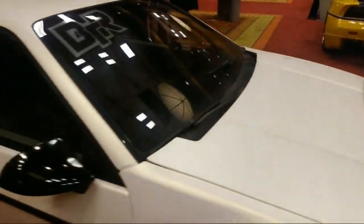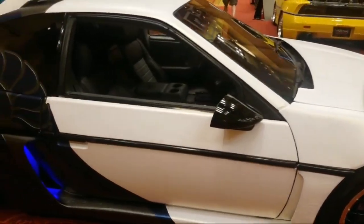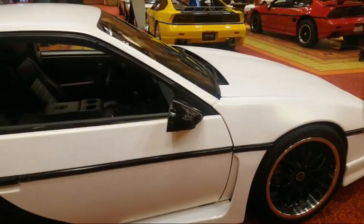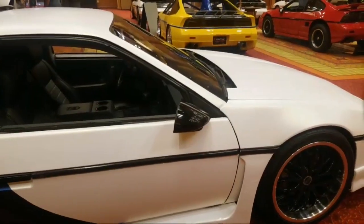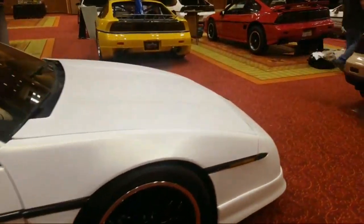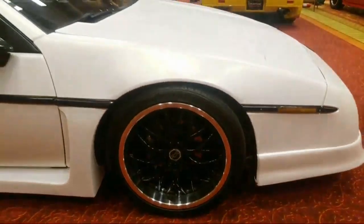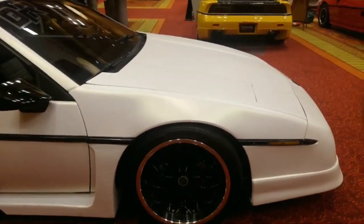You got some pretty good fitment there. Spacer on the back, the front was not. It's the Eibach lowering spring kit, and in the front we've got Rodney Dickman's 1-inch lowering ball joints. Is it a 2-inch or a 1-inch lowering? I'm pretty sure it's 1-inch plus the lowering springs. Oh, are these 18s? Yeah. With the Eibach kit, the back was actually lower than the front. Looked really stupid, so we did the extra drop in the front with the bolt holes.